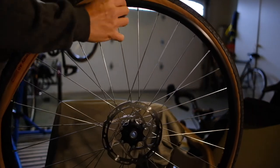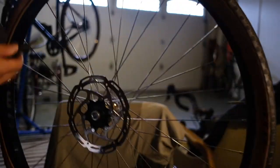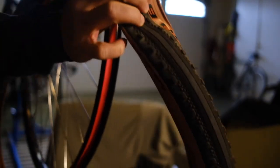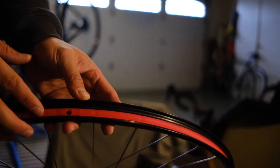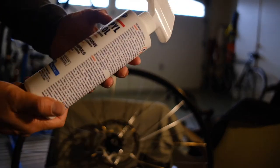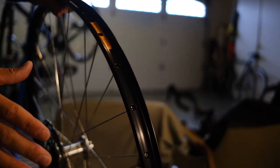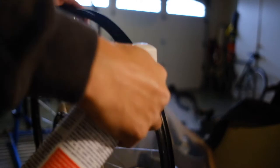Once you get the tire off the bead, you get a little opportunity to take everything off, then everything just comes off easily. Unscrew the valve and take it off — there's the tire and the tube inside, toss that to the side. The very first thing you're going to do is take off the old rim tape. Also, I forgot to mention: it's a good idea to get some isopropyl alcohol to clean the inside of the rim, because that'll help make the tape stick as well as possible.